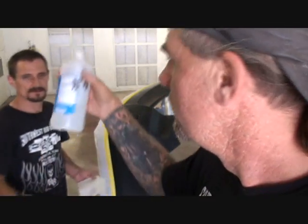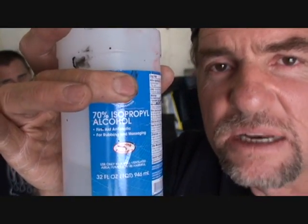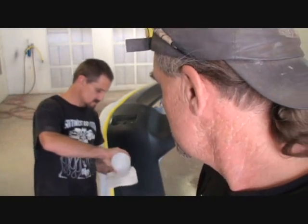If Charlie can hand me that - this is the key element for your paint to stick to your bumper. Your raw plastic bumper is right there. Rubbing alcohol. It's hard to believe but it's true facts. What it does, it extracts all the foreign material out of the plastic. Make sure you saturate that and wipe it down thoroughly. It extracts all the contaminant materials out of it, cleans it off thoroughly, and gives the plastic a very, very high quality surface for paint to stick.